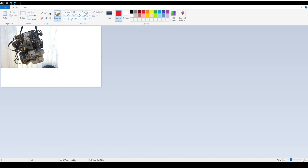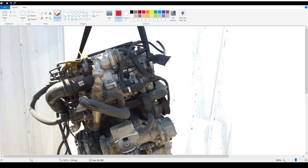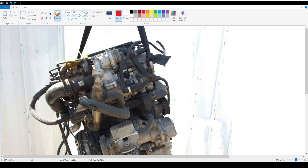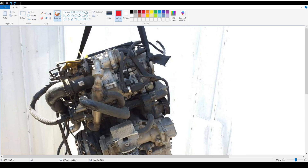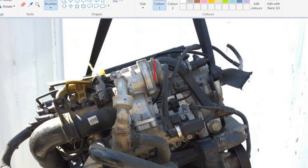To illustrate it a little bit easier, this was the clearest picture I could find of the back of the engine. If I just zoom in just that little bit more — we've got the entire engine, this is the back of the engine here, and the part I'm going to be dealing with is just this bit here. I'm going to be undoing one bolt there, and there's going to be a bolt on the other side, which you'll see in the video. I'm not going to be dealing with the rest of the EGR system here — you've got the EGR cooler, which would go all the way down here, and you can see it's fed by these coolant pipes here from the thermostat.